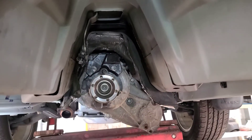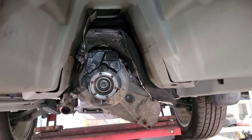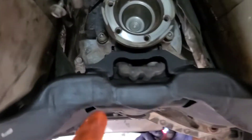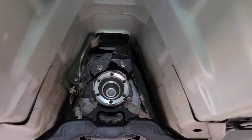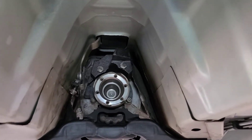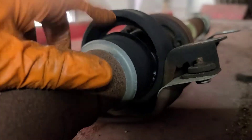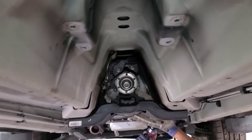We got all the bolts secure. Now we're gonna put the mount so we can lift it up, and then we can start putting the driveshaft and so on. Alright guys, we already put the mount — two bolts over here and the four bolts on the bottom. We're putting that front driveshaft on at the moment, and then we're gonna be putting this back on, which is the selector. We're gonna put in the back shaft. We have a bad bushing here, so we're gonna have to order that and come back another day to disassemble and take the bushing out. But other than that, we're just gonna keep on putting things together.